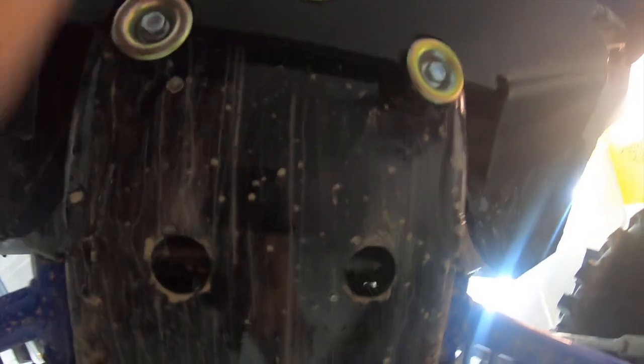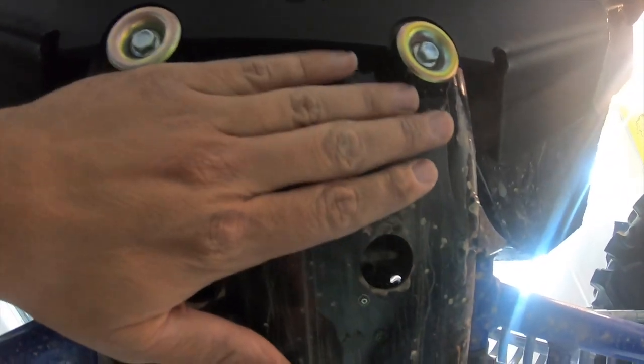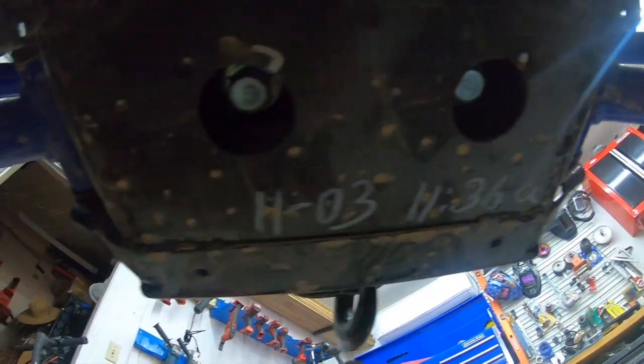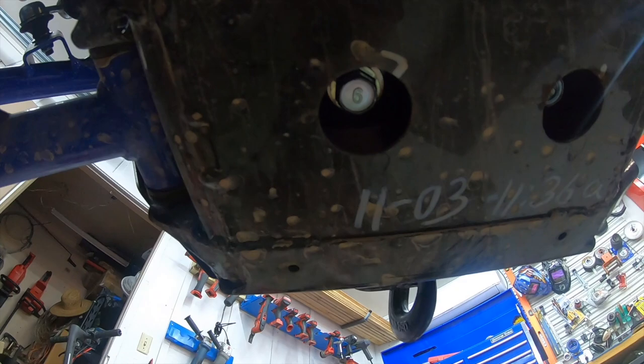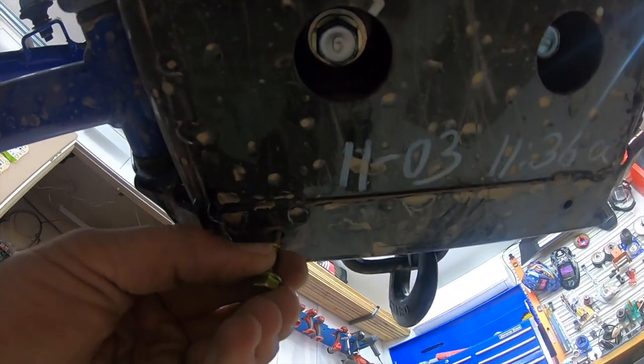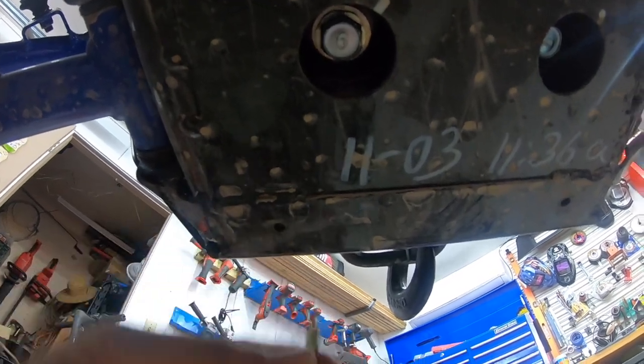So I have these on. Everything's nice and loose, as you can see, it moves, and these are loose. I'm gonna slide that in here. But if you look, you're not really drilling too hard. There's a hole, and those are where the 1-inch tech screws are gonna go into. So you don't really have to push too hard, and again, don't over-tighten.